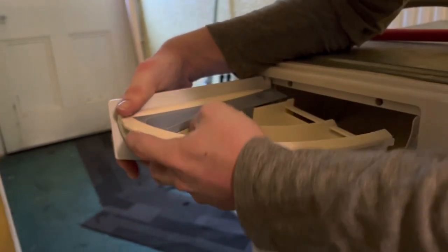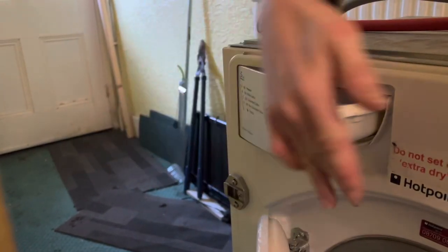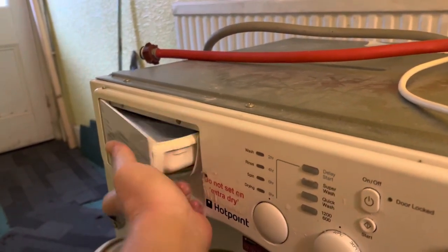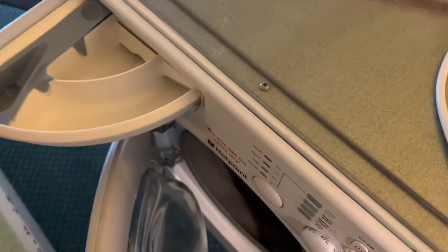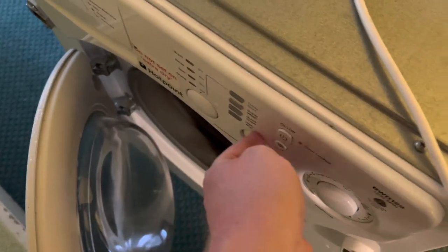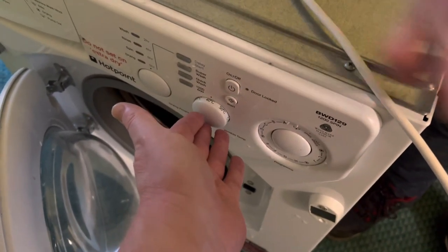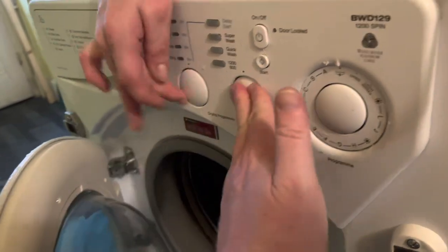Getting that back in and clean, there's a good chance of getting this back together. It's not sitting right - no, it's better now. Everything's just covered. I wonder if it was brand new and that's just never been used - absolutely everything is covered in fabric softener. That's working fine now, but all these buttons are gunky. I honestly think it's just going to have to be cleaned - all the front fascia buttons and everything washed to get all the gunk off. You can still get the front fascia potentiometers - I don't think you need them though, I think it just needs cleaning.